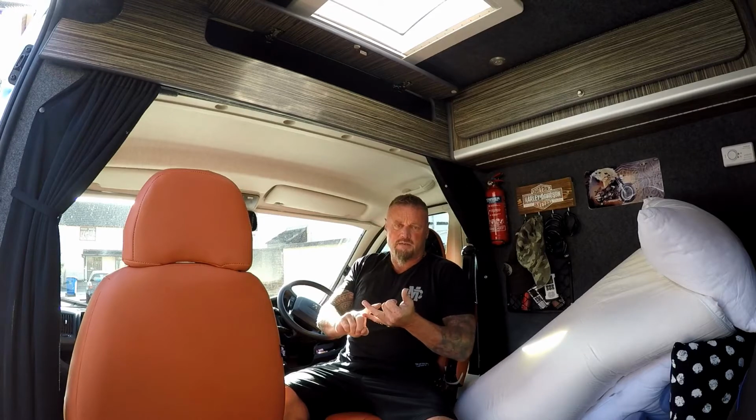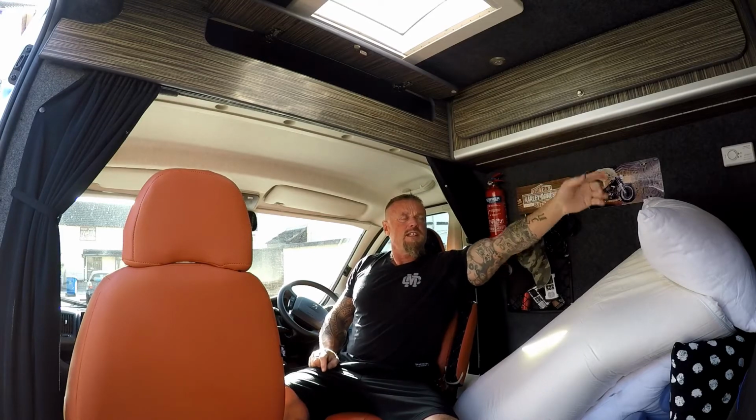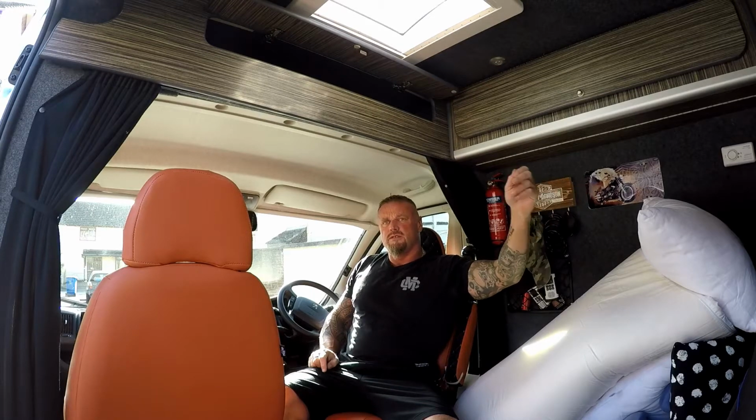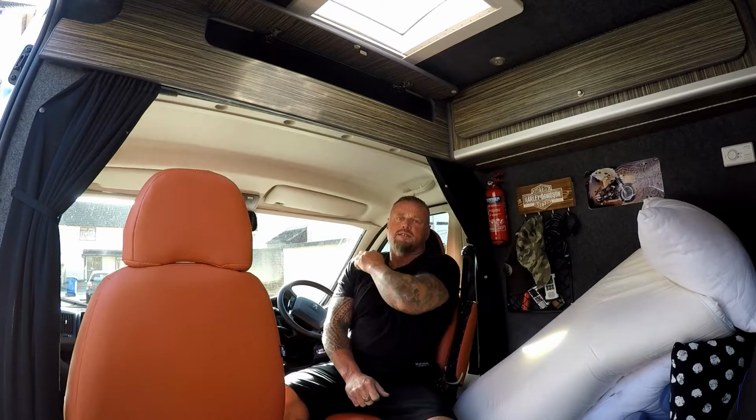So we've got the solar panels installed. It's all wired in and running. Everything's going good, plenty of amps and plenty of watt power. We've got the lights on here installed and working. We have the lights in the bathroom installed and working. And now, we drilled in the two reading lights above the bed yesterday. They're wired up, we're just going to wire them into the power now and then finish off all the wiring, make it tidy, that kind of stuff. Put some shrink wrap or heat wrap around it. Alright, so let's get started.